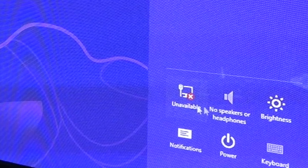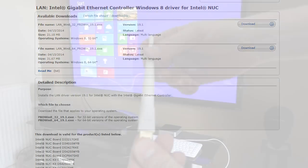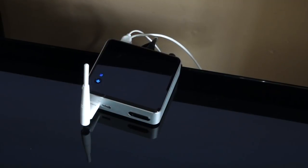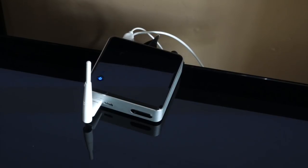So I did a bit more investigation. It turned out neither the Gigabit Ethernet nor the Wi-Fi would connect to the internet until I downloaded some drivers off the internet — so that's a bit of a catch-22. Luckily I had this Wi-Fi adapter — once I plugged that into the USB port it recognized it straight away, enabling me to go on the internet and download loads of updates.